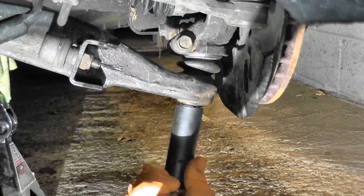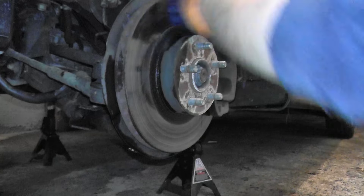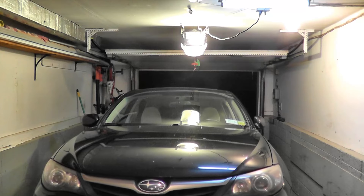When you're ready to reinstall the brackets for the sway bars, as you can see there's an arrow pointing toward the front — make sure you install these brackets in the correct orientation. This is just some brake cleaner to clean off the rotor. That's what it takes to remove one of these, in this case from a Subaru. I'd say maybe three hours if it's your first time — do it on a Saturday. Give yourself enough time and leave those comments. I love to hear how you guys do this. Thank you for watching.